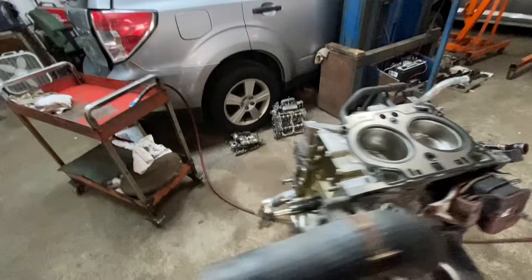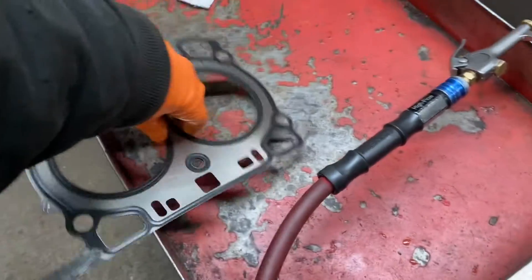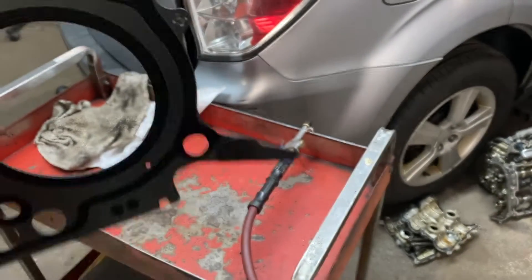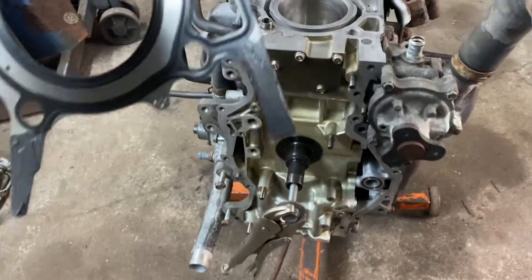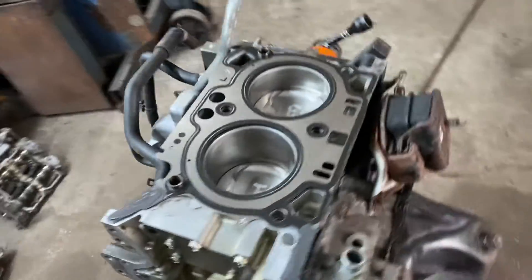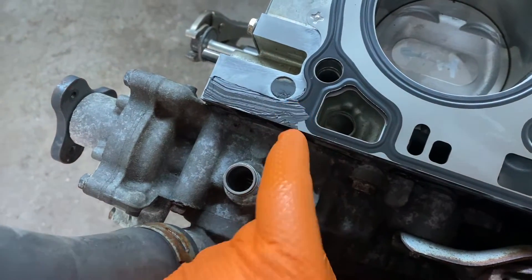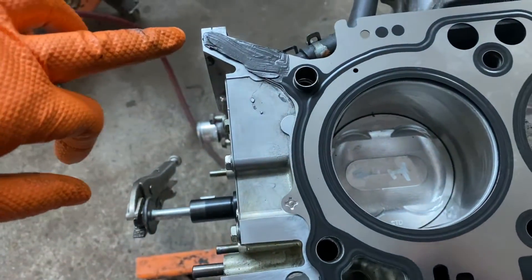You're ready to go. Now we're going to install that — I'm going to put the gasket maker on there and then put the head on. Put it on a tip like that, on the other side like that, and like that. Then you just put it down, and it should look like that. As long as the gasket maker touches the black of the original gasket on both sides — that's what they want.